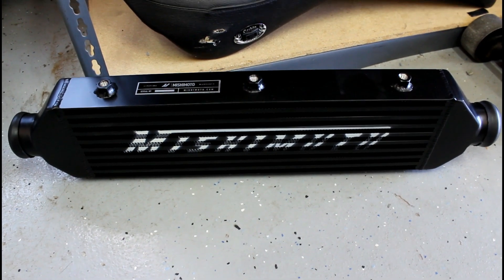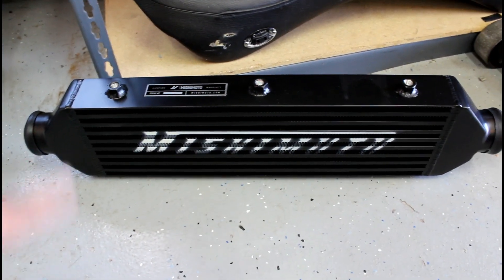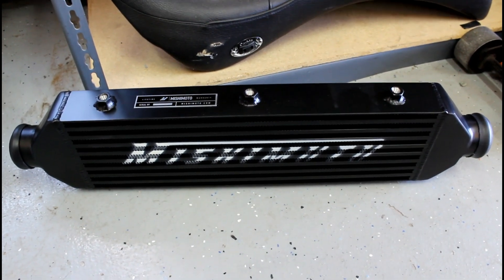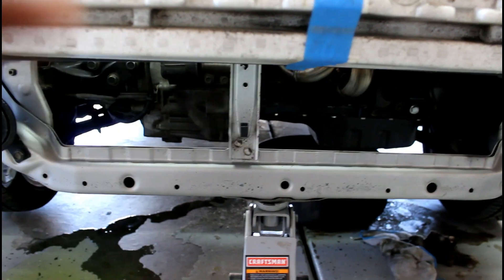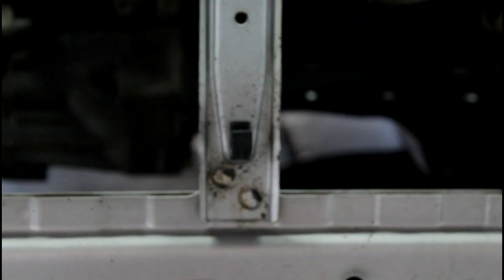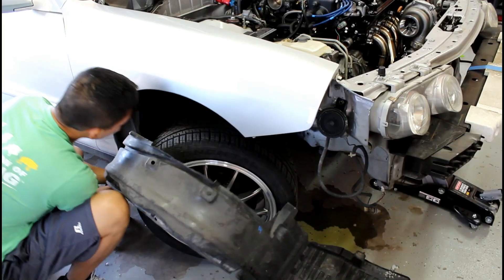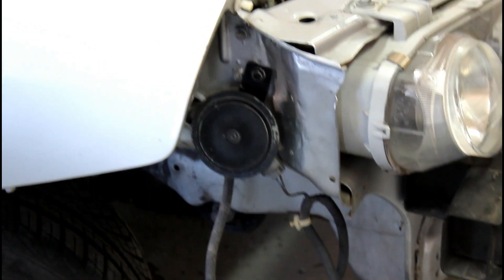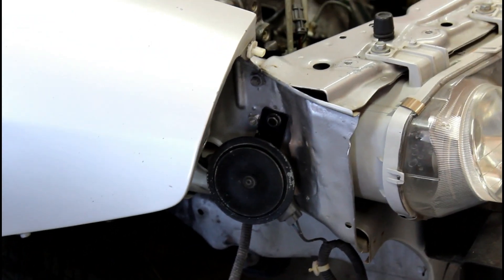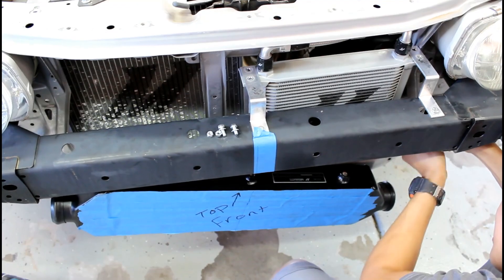We bought this J-line intercooler — it should be just thin enough to fit, but it's the widest and tallest one we could get from Mishimoto. We think it'll work out good. We're putting the intercooler in front right here, so there are a couple things we need to remove: that little clip, and we need to move the horn because the intercooler piping is going to wrap around on both sides. We're also taking out the inner wheel wells so the fab guy has nothing in his way. The horn got relocated to a spot that already had a 10mm bracket, probably for the factory airbox.